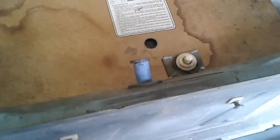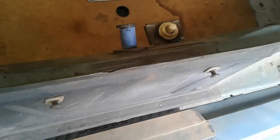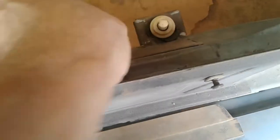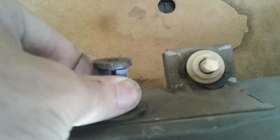You don't need to replace the whole thing, though you could. I don't know where to find them, because I believe the striker bolt for all three corners is different than the striker bolt for the doors. These are awfully difficult to find and you need the right one for it to work. So what you do is when there's no nylon thing here anymore, you replace it with your own.